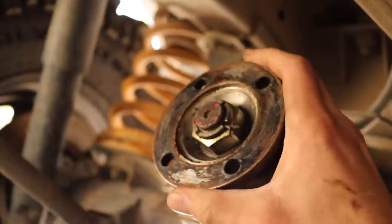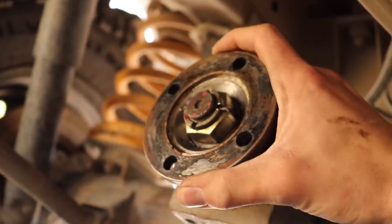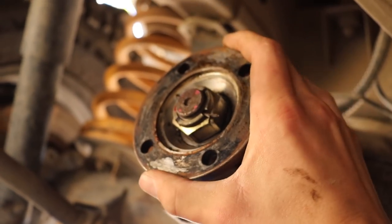Oh — hold up, I forgot to mention: that's the rear driveshaft, which has currently been pulled because there is something very unhappy going on in the back diff. I filmed a clip to show you — as you can see there's a little bit of slop, but if you push harder there's a whole lot of backlash in that diff, which is not a good thing. We'll pull the diff and find out the story. We'll probably be doing a few more shed vlogs, but I am hoping to get out four-wheeling again. Anyway, give us a like if you enjoyed it, subscribe, leave a comment, and we'll catch you in the next one — cheers!